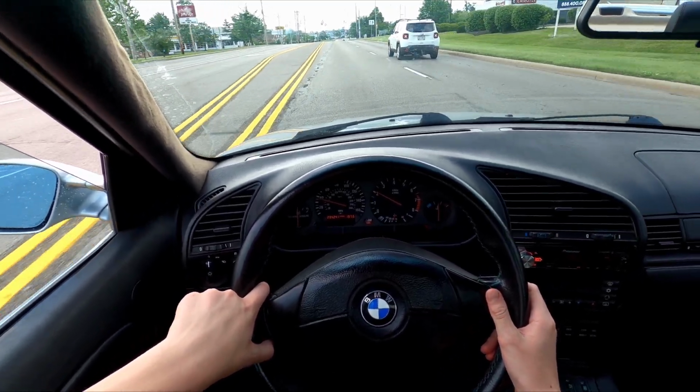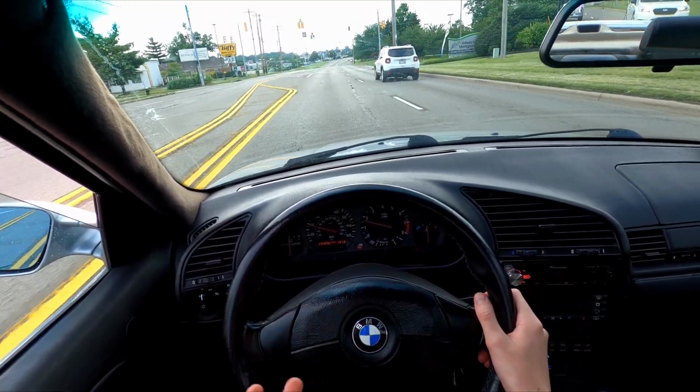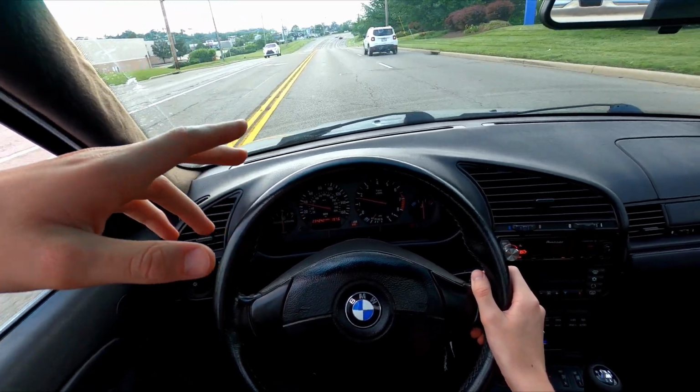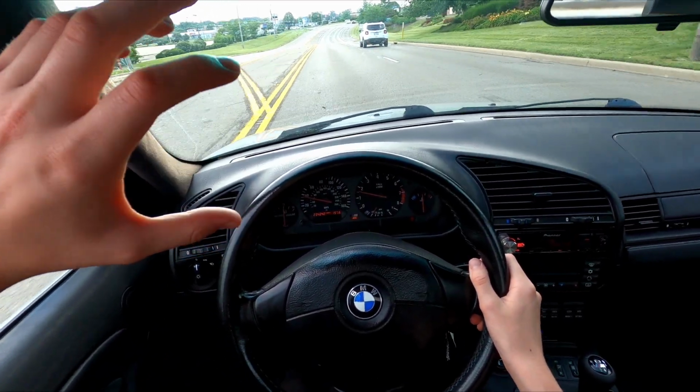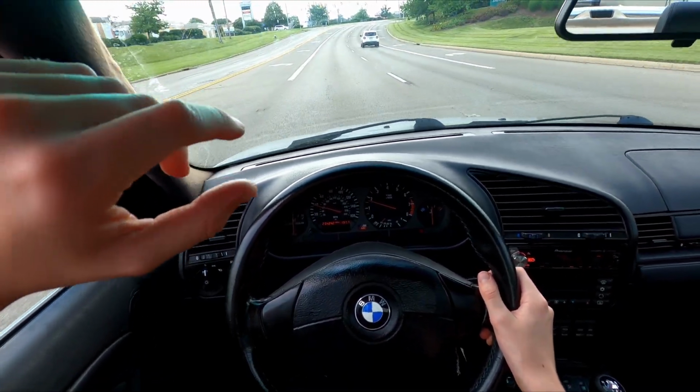Chatter's gone down a lot, and I think it's at where it's gonna stay. I also stock idle. Something that can help chatter is raising your idle. Someone told me 950. It's a little high for me. I might go like 750 and kind of go from there, see what it is for chatter.